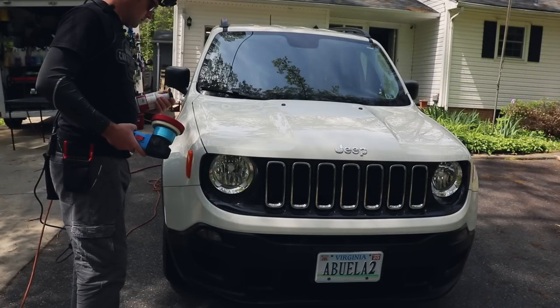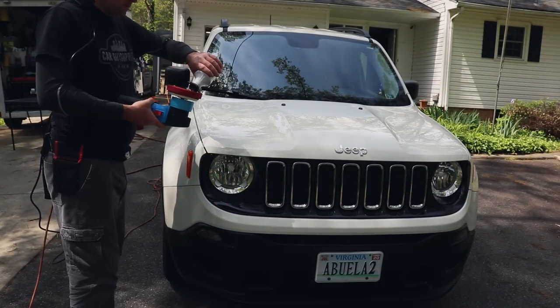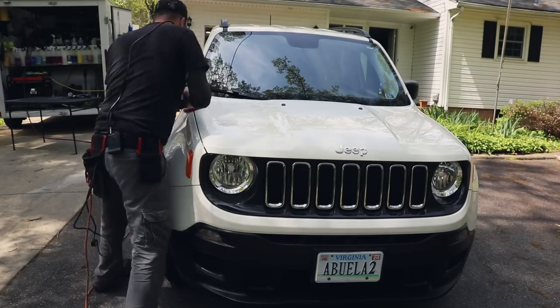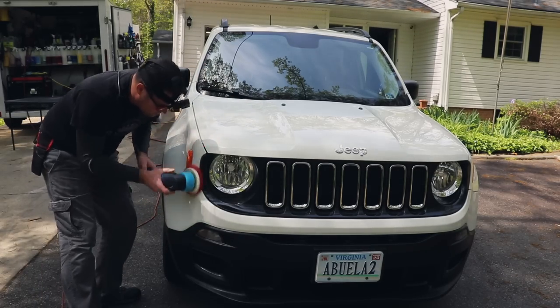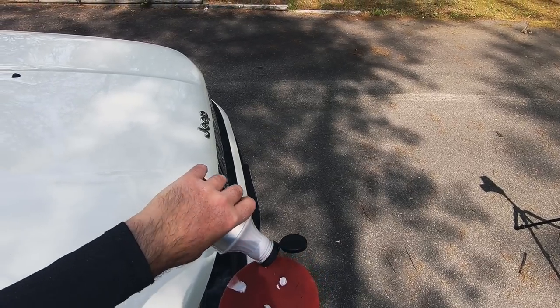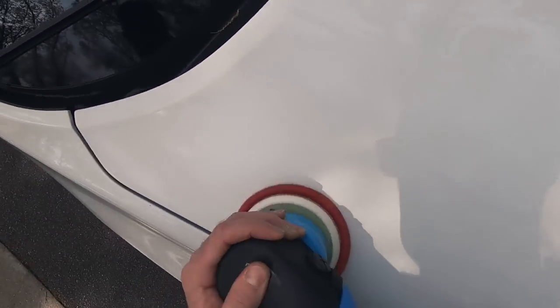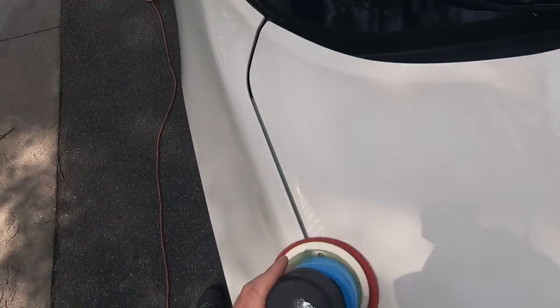We love to machine apply waxes and sealants in this manner. It's fast and efficient. We use the DA polisher on speed 4, just enough to apply and lightly polish, leaving the paint glossy and smooth. We also use less product than hand applying, at least for us. We've tried it both ways and find this method to be the best for us.